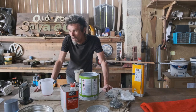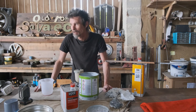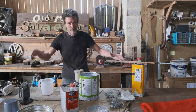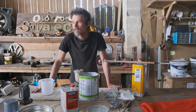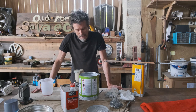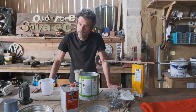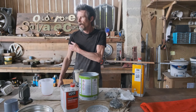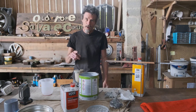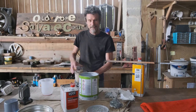I'm exhausted. We've got prepped up a door — I think it's the passenger side door — a little wing, and one of the big wings. That's all I can fit in there at the moment and all the bins I've got to put stuff on. So they're going to get sprayed in some high-build primer. They look pretty good, so hopefully we've done enough prep work. Like the door, we have to paint one side and wait for it to dry and then turn it over and paint the other side — but that's cool because we can stagger the panels with each other.